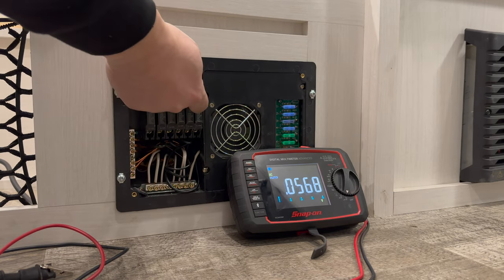I've gotten some extra length of Romex and connected it up to where the generator or inverter wires feed into the relay. That wire comes all the way around back here — I cut a hole for it to pass through — then it comes up here and I'm connecting it up to the inverter. I take off the cover, connect my wires onto this side, and the inverter will be able to supply power to the transfer switch. I've also run the cable from the charger through that hole. After testing the inverter, we'll connect the charger up as well. I have all those wires connected and can now set this down.